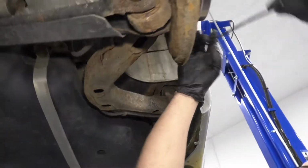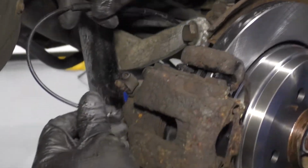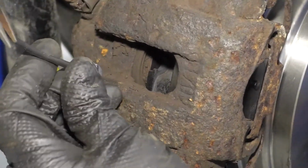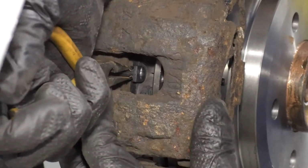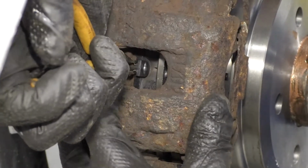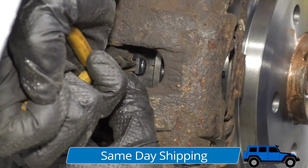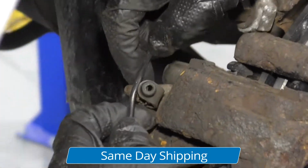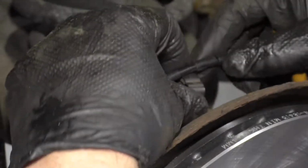All right. Before I lock these retainers in, I'm actually going to install this onto the brake pad. You can take some needle nose pliers to help you. Just slide this in position at the brake pad. And push. It'll lock in place. And slide it over here where the bleeder retainer is. Push that back down. And then you can line these all up.